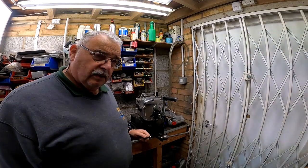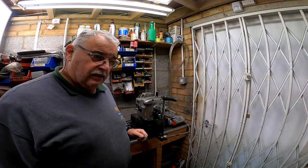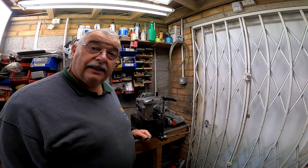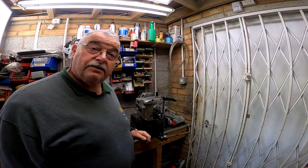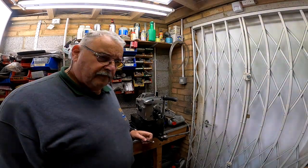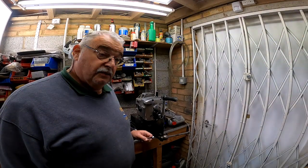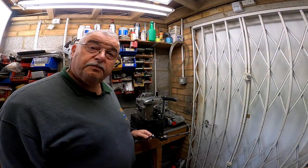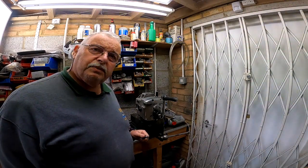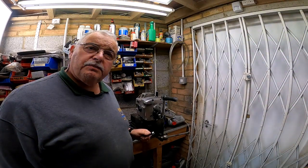Obviously it gets to the point where cold oil will not flow, but from my experience the issue really is simply getting the damn thing to make a spark. There's a minimum revs per minute that the engine needs to make a spark, and I was struggling to achieve that with 50 weight oil in it. So I'm going to sort that out. I don't do an awful lot of motorbiking on the Velocette when it's bitterly cold, but the idea of not being able to start the damn thing when I want to doesn't appeal to me at all. So I'm going to sort that out, and that'll be the next video. You may be interested.